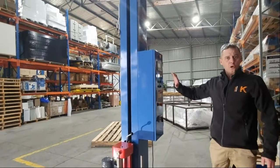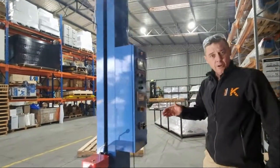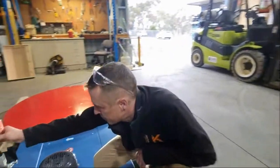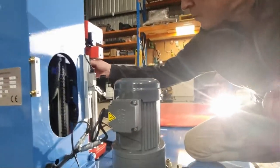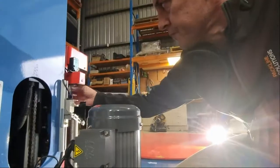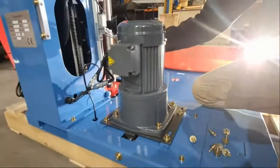I can't move or navigate myself around the menu screen. So what we have to do — always turn the power off when you're working on machines. As we come around here, we get under the film carriage, there's a little 10-pin connector. We unscrew it, which removes all electrical signals to the film carriage.